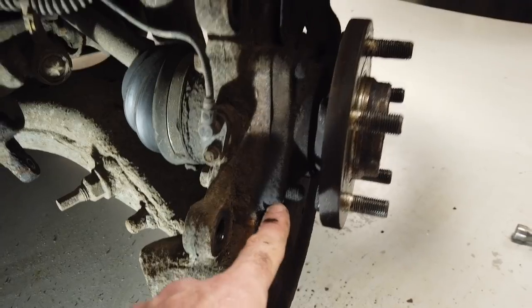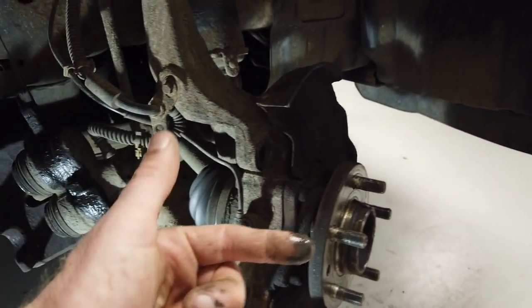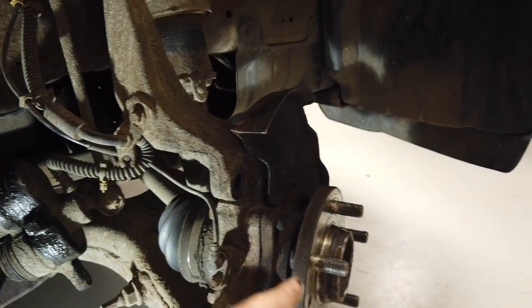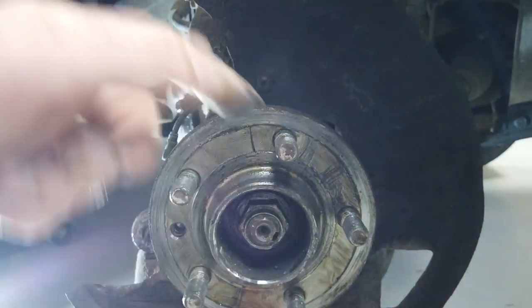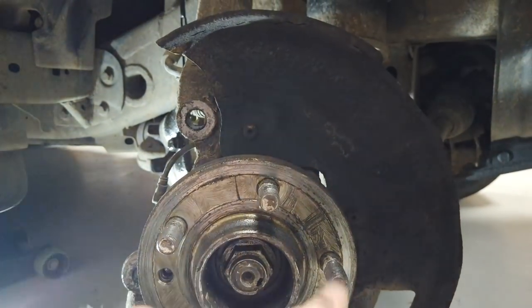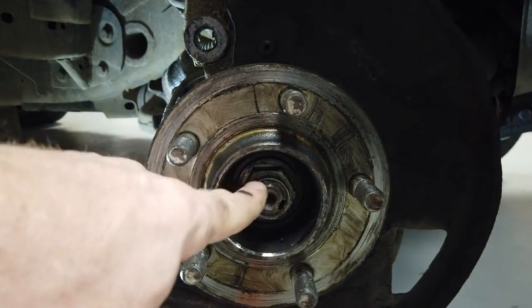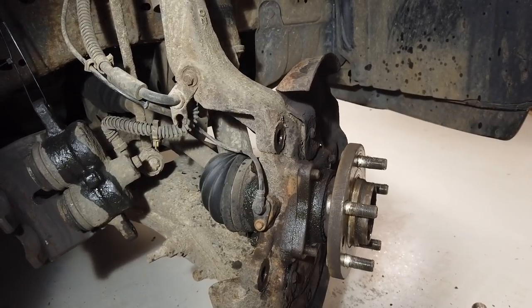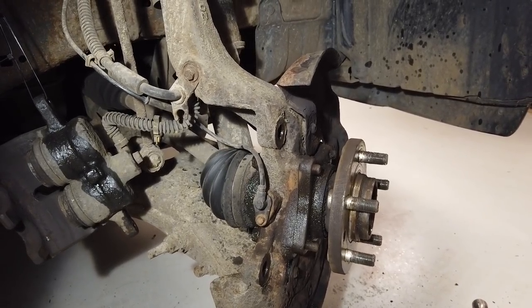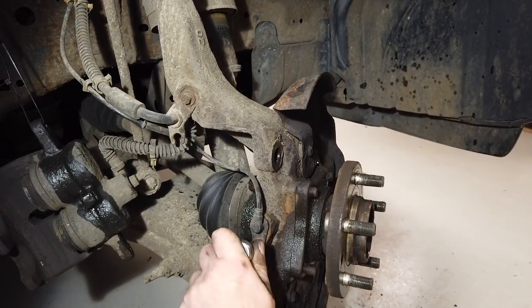We're going to clean up these little threads that are sticking out - WD-40 those up. The problem we've got is we've loosened the nut, but the question is how do we pull this out because often you've got the splined drive shaft going in here. The drive shaft drives it - it's splined onto this hub because that drives your wheel. Get that nut off and get some WD-40 in there. Next we've got to take the ABS sensor out - we've left it all soaking in WD-40. When the wheel bearings go, the shaft can wobble and damage the brake sensor. Let's see if we can get that out - it's an 8 millimetre socket.